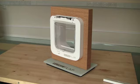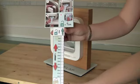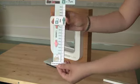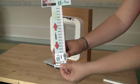If the microchip cannot be learnt, please remove SureFlap from its installed location and repeat the learn process. With the microchip stored in memory, the range tester is ready for use. Slide the microchip to the small end of the range tester as we are showing here.